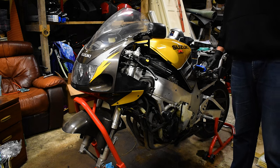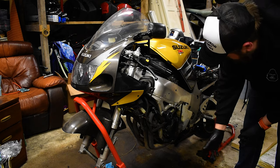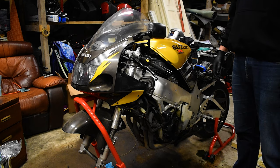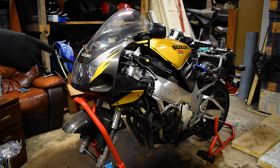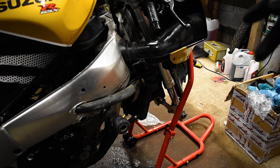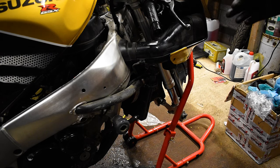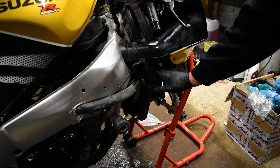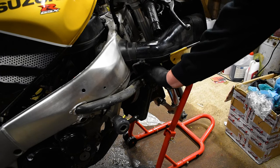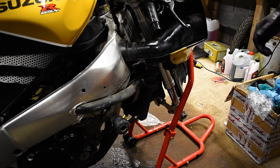It's running well and it has all new coolant in it. The level is still good here, which is a good sign. I think that's pretty much good to go. The last thing you need to check is on the radiator side of the bike — pop that cap open again and just top it up, because any air that was in the system will be forced up to here — it's the top point in the system. Just grab a rag when you're opening that. Don't burn yourself — and if you do burn yourself, don't blame me.